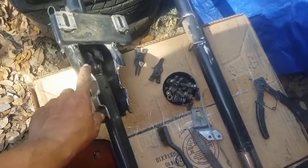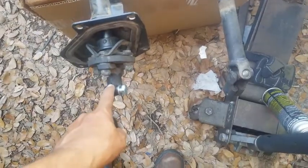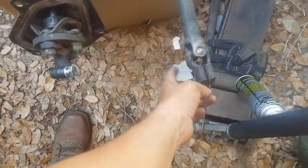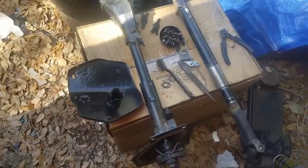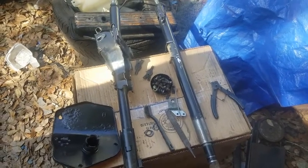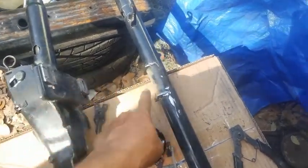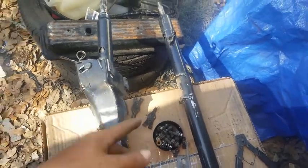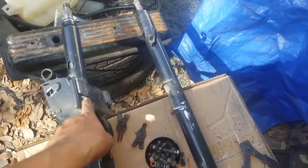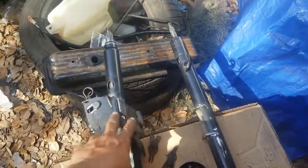And if we did move the 720 column to mate with the D21, that would put this end even further, which would be even worse. This part wouldn't even mate with this part of the shaft at all. If I had to do it over, I mean, this is my first time doing this, it really was a learning experience. But if I had to do it over, I wouldn't have chopped off the bracket from this one. I would have left that on there, that way this could still be used if needed. And I would have gone to Lowe's or Home Depot and got a similar gauge metal and just copied this bracket. Use it as a template and copy it onto the new plate, cut it, do whatever mods had to be done to it, and then weld that to this, and that would have been the end of it.